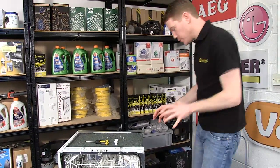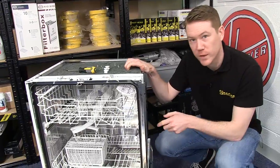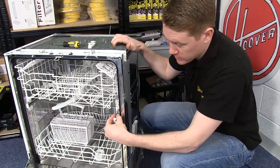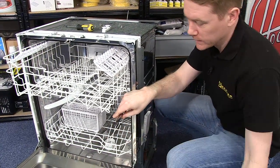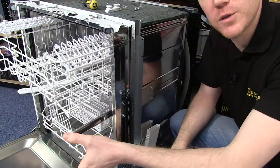With the side panel removed I can now see the two screws that hold the rail support wheels in place. Because I'm removing the front rail support wheels I can just remove the end cap on the rail, and when the screws come out I can simply slide the rail support wheels off.